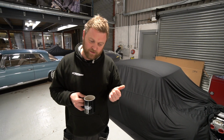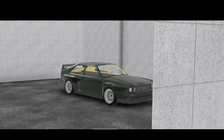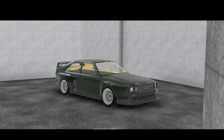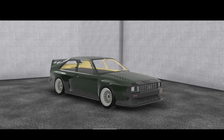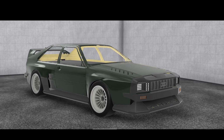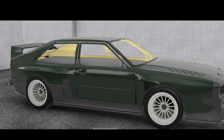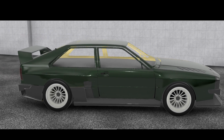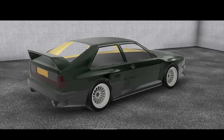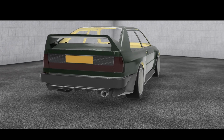And then in the meantime, George has been on with the Quattro. So again, it's really just moving forward, refining all the shapes. It's kind of incremental changes again. So I go up there, we both look at where we've got to with it, discuss proportions of things. So we were bringing the rear bumper in slightly snugger, changing the shape where there's a sort of zigzag shape at the side of the bumper, trying to make that look more intentional rather than just look like a crack in the bumper. So we were bringing that out, making it more three-dimensional, so the upper part is proud and the lower part sweeps around more tight to the body.